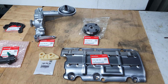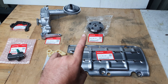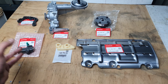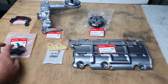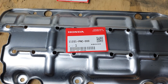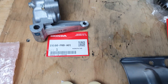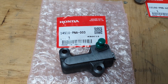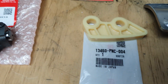Here's all the parts you need to upgrade your K24. We've got a Type S oil pump, the 50-degree cam gear, the windage tray, the guide for the oil chain. And seeing how we're pulling the engine apart, it's always advisable to replace your tensioner. So we've got some parts here with part numbers — these will also be in the description. That's the one for your windage tray, that's for the cam gear, oil pump, chain for the oil pump, a brand new tensioner, and your guide.